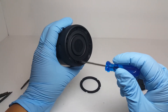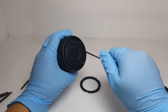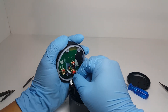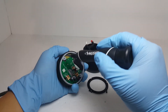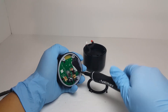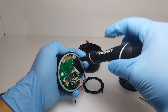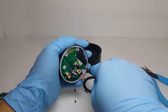Next, we will need to remove four screws that hold down the base onto the speaker. We will go ahead and disconnect the speaker and power cables. In order to remove the motherboard, we will need to remove four screws and disconnect the microphone. I will use a razor blade to carefully cut the glue so it will be easier to take out the motherboard. After doing so, the motherboard should just come out just like that.